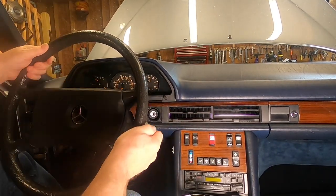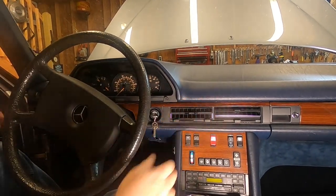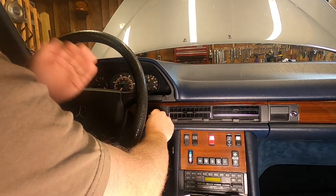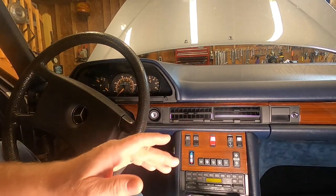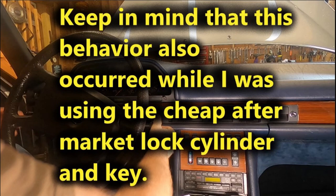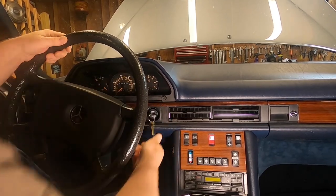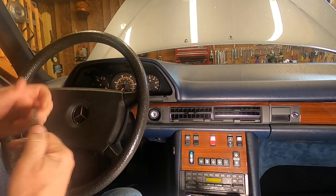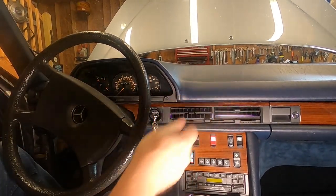Let's do it again — not quite so bad this time. Pull it to the left a little bit. There you go. Let's do it one more time. Steering lock is on. All we've got to do is a gentle nudge of the steering wheel to get it to release. If you recall from the previous videos, in order to get it to release with the old key, I had to go back and forth like this and eventually it would turn, and it was really hard to do. But now, with the steering lock under tension, a simple bump to the left — and she gets released.